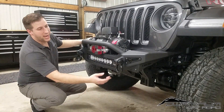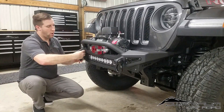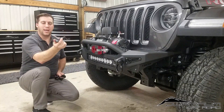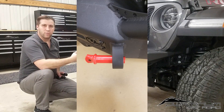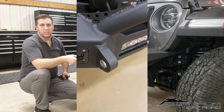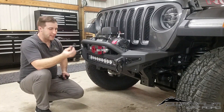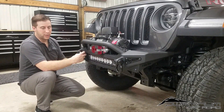You can fit a set of three-quarter D-ring shackles through here. One issue we had: when we put the three-quarter shackles in initially — these are powder-coated — the main pin would not fit through the hole. We measured and miked it and found it was just a hair over three-quarter inch after the powder coat. So if you're going in with a powder-coated pin, know that you'll need to bore this out just a little bit so the pins slide in and out easily.